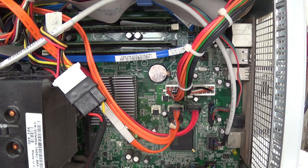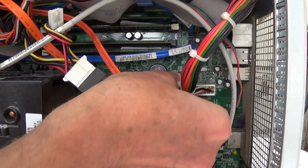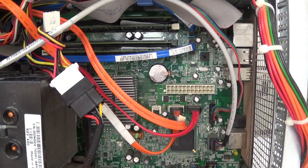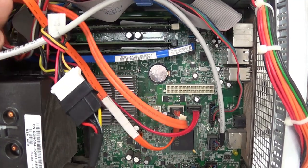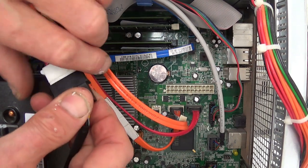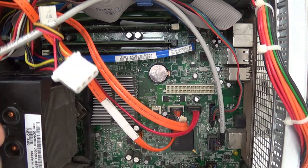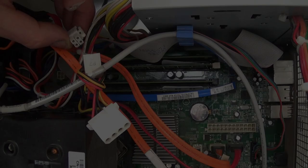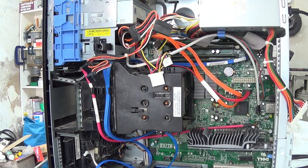So let's go around the power connectors one by one. Underneath the main motherboard power connector there's a little clip — if we press that clip we should be able to pull this off. Then we've got power to the back of each of the drives, so they just pull straight out. There's power to drives down in the bottom — I've already taken those off. There's a flying connection here to a USB 3 card down the bottom. There's one more connector at the back — the 4-pin CPU 12-volt power connection. That was a bit difficult to get out because it's tucked down inside there.